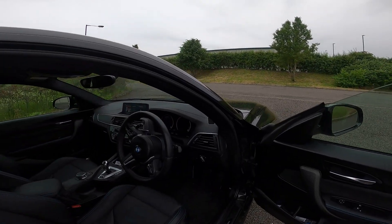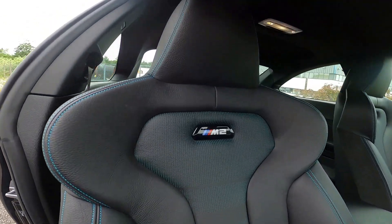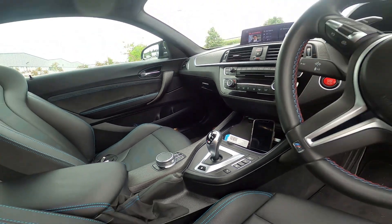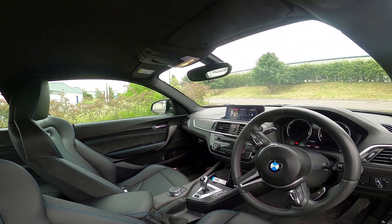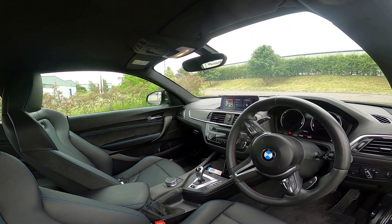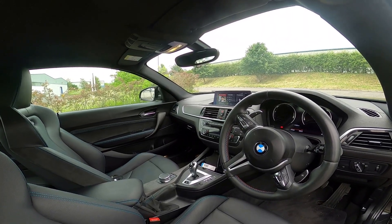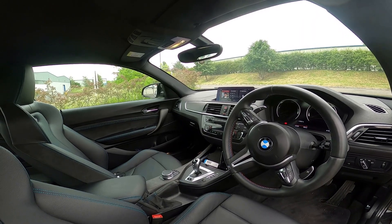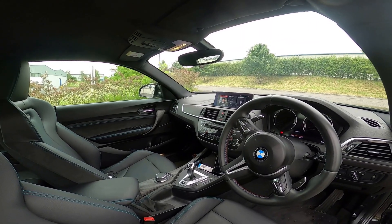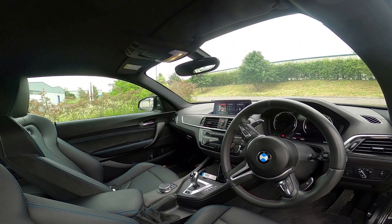That's a quick look at the engine bay. Inside, it's standard basic BMW — not the latest technology but it's okay. You've got the upgraded M2 seats, and those little M2 badges light up at night. The DCT gearbox — a lot of people ask about these. They are a little bit different to your normal gearbox. When you stick it in reverse or drive, it does take a couple of seconds to engage, so be wary of that. It doesn't engage as quickly as you might expect, especially for a three-point turn. There's no manual park function — when you stop, press the stop button and it automatically puts itself in park.